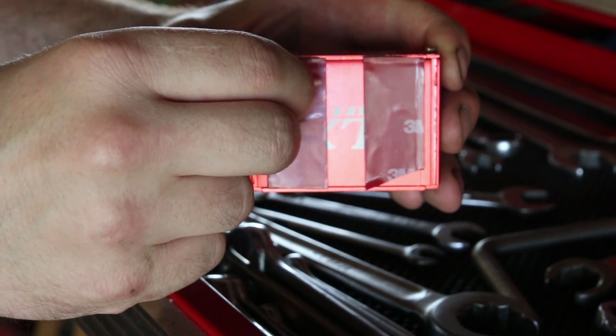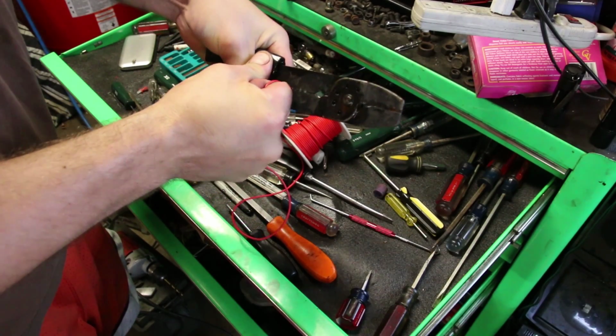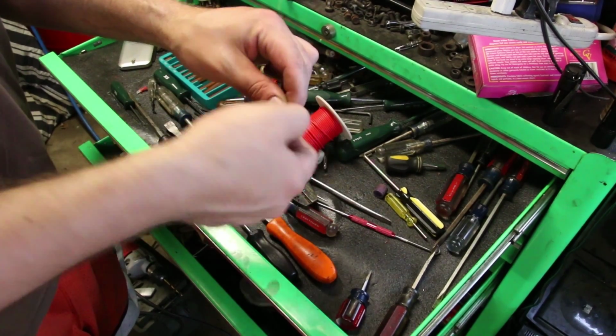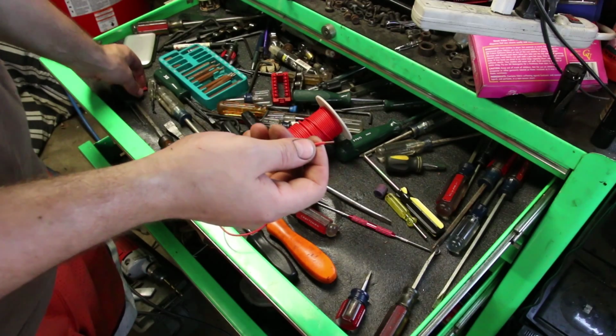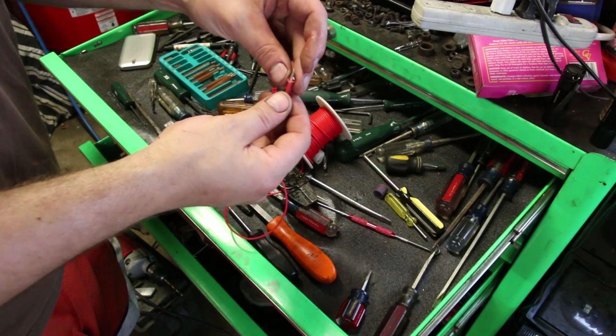A little bit of a period-correct addition to the car. Alright, we're going to go ahead and strip a wire so we can get 12 volts to the wideband controller. I'm stealing a spot that's empty in the fuse block for that, and going to run a 5 amp fuse in line with this behind the dash, as recommended by PLX. Once we get this terminal crimped on here, we're going to be good to go.